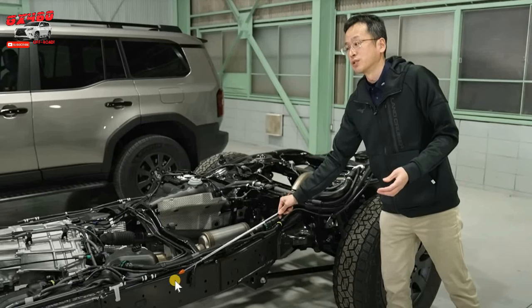The engineer explains that this cross section in the ladder frame has been made thinner compared to the Land Cruiser 300. His reasoning is weight savings and material savings. It's up to you to decide if that's legitimate or more of a cost-saving measure, because this whole frame is the same size as the Land Cruiser 300, but they have to sell the 250 way cheaper. Is this weight savings in the name of engineering excellence, or penny-pinching to increase profits? The bottom line is: the engineer says we made this frame thinner — this cross section uses thinner materials than the Land Cruiser 300.